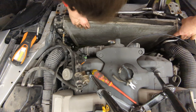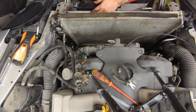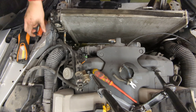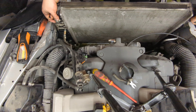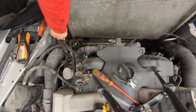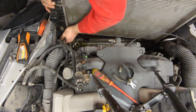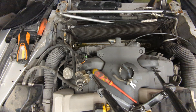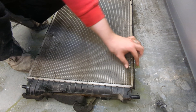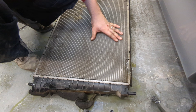The condenser's off and it should just lift down now. My god, that's tight. In theory it should pull out but it's not doing. There we go — effort! And there we have it. It was leaking from there. Could be a result of the accident — maybe a little bit of debris hit it. The rest of the rad looks good. Remember this car's only done 40,000 miles. Not really sure, but that's the issue. Let's try and get another one now.